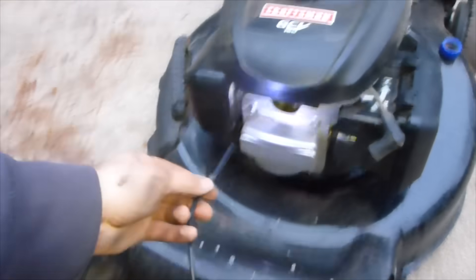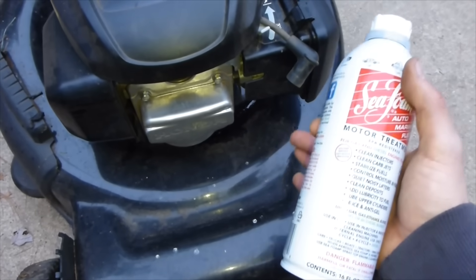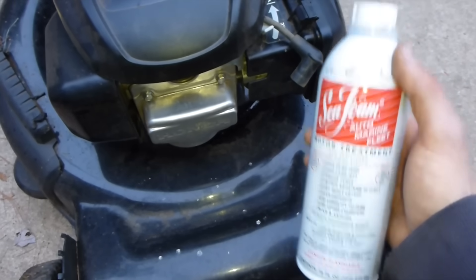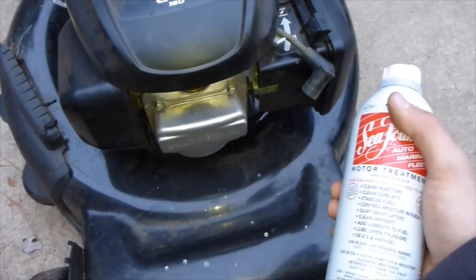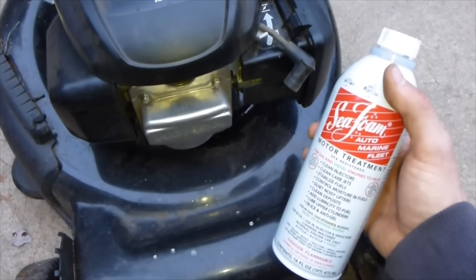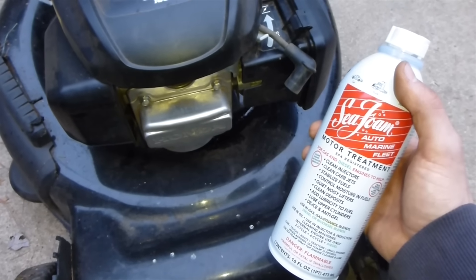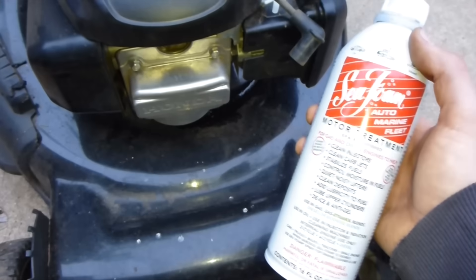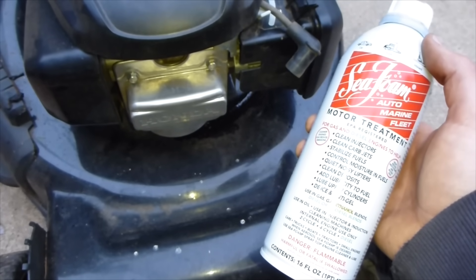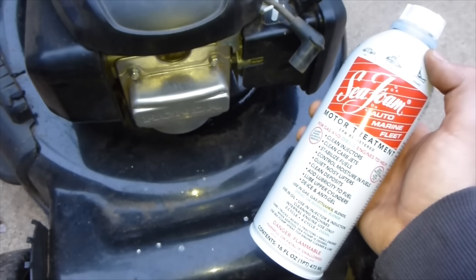Well, there you go — I'm pretty impressed. I am using a carbureted small engine, not a car, but I'm curious to see how this is going to work on a car. For a small carbureted engine, this worked pretty good, and this is actually the kind of results I've been waiting for. You saw me test the gum out and I was disappointed with those results, but seafoam — I was actually pretty impressed. You can see a clear before and after. A lot of that carbon on the piston head was cleaned off, and that was using only one third of the can. Maybe if I used more than a third, it'll work even better.